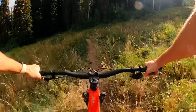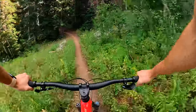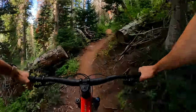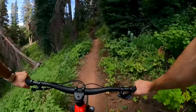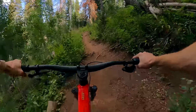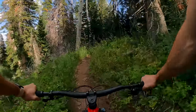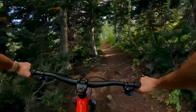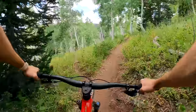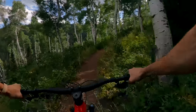Santa Cruz has lowered the anti-squat value, which theoretically gives you a more active bike, leading to a bit more pedal bob under pedaling forces. On the flip side, you get a lot of traction, smoothness, and control, with a little less feedback through the pedals. The more technical, steep, and loose your trail gets, the better that back wheel sticks to the ground. The 5010 is an excellent climber in technical terrain and a good climber in smoother, faster terrain — it's probably not efficient enough to hang with bikes like the Spur, the Element, or the Ripley in smooth stuff, but it will beat all of those in technical climbing.